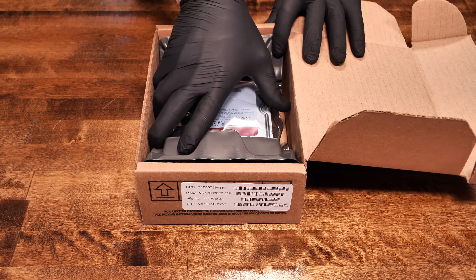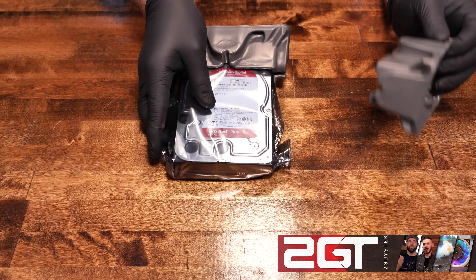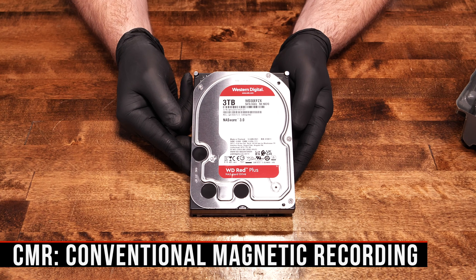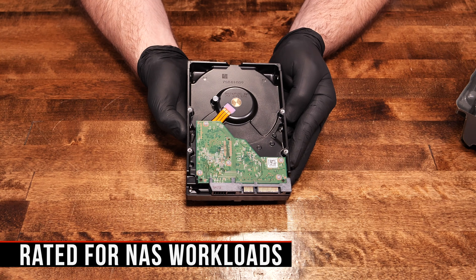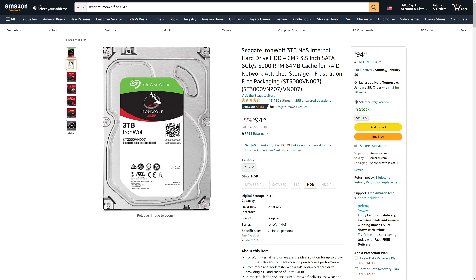For the replacement drive of our Scale host, we've chosen a Western Digital WD Red Plus drive to replace the failed Seagate Constellation disk. The WD drive was chosen for a few reasons: one, they're CMR, or conventional magnetic recording drives, which will not degrade performance over time; and two, the Red Plus drives are NAS-rated disks designed specifically for NAS workloads. If you're a Seagate fan, get yourself an IronWolf — they're equivalent.